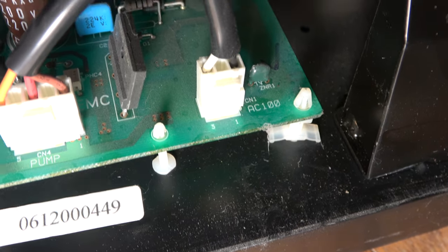There's not a fault there. So why was I not seeing that on the unit itself? I wasn't getting 5 volts. Have we got an overload on the 5 volt line? I was kind of half expecting that 5 volt regulator to be burnt out. But let's take a note of which colour is which voltage. Okay, I've proven, well, fairly much proven, that there are no faults with the power supply. That's a somewhat strange result, but I thought I was going to have a fault with the regulator, but seemingly not. So why are we not getting those voltages at the unit? Maybe there's an overload on a 5 volt rail. We'll look into that.